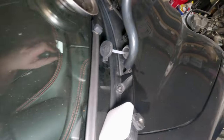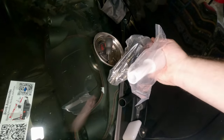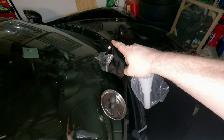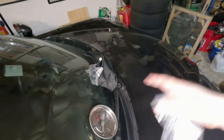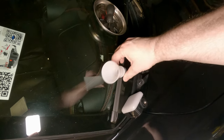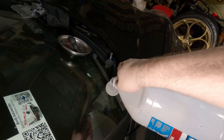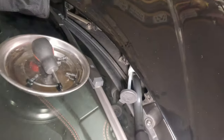Take the little swan neck doohickey and shove that down in there. One of these funnels is supposed to be for the washer fluid and the other for the brake reservoir — which is inside that little panel over there; I actually took the whole hood off when I messed with that. Once you have the little swan neck thing in there, put a little funnel on and pour the fluid in until it's full. How do you know when it's full? It's gonna make a mess — just like that.